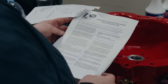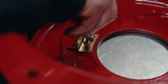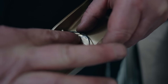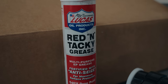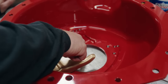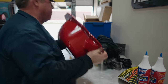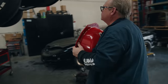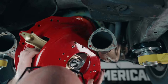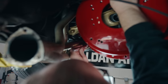Then it was time to prepare the bell housing. We were a bit confused by the instructions because the diagram showed multiple parts and brackets for different types of clutch forks. Gary measured both bell housings to verify the correct setup, then reused the wire from the old clutch fork and installed my new gold clutch fork with a little grease. Gary tried to attach the wire to the new bracket but had to slightly bend it for it to accept the wire. He put a little grease on the new throwout bearing and installed it, then had to carry the insanely heavy bell housing over to the car.